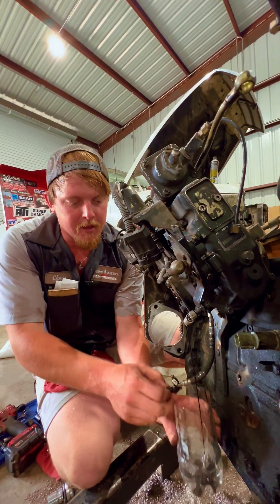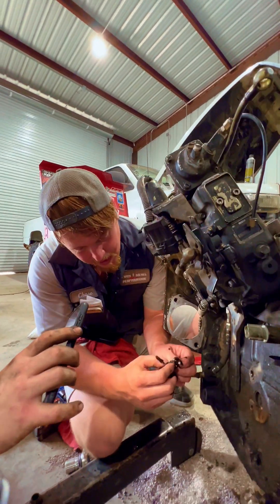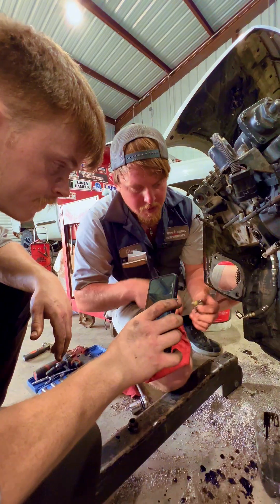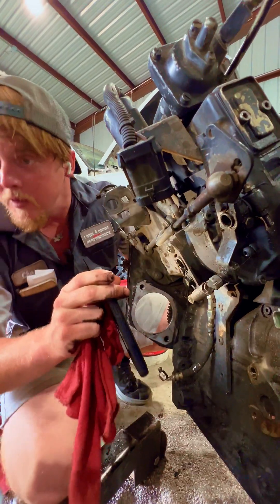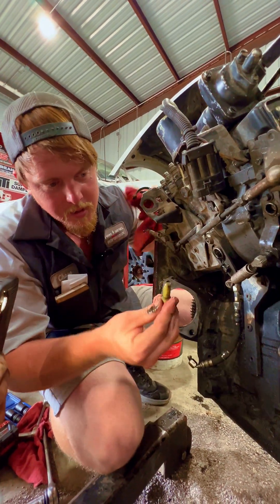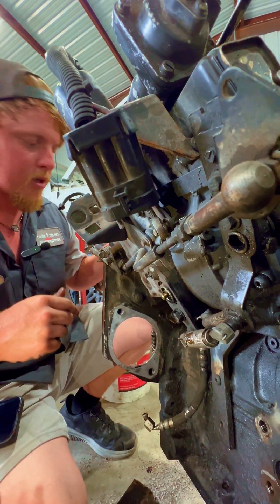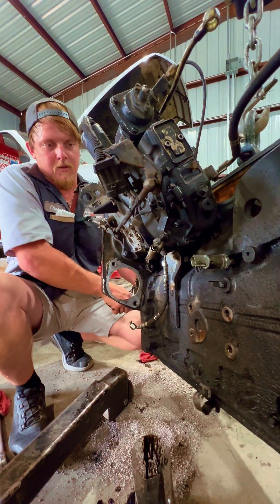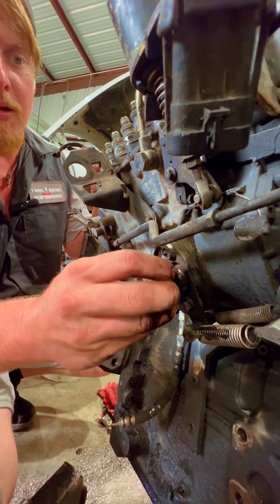Pull this out, then we can put a little oil out — just like that. You see this slot? What you do is find it, make sure it's lined up, stick it in there. On the outside of that — you see right there, you see that key? You have that horizontal like that. Look in there, you see the pin? It looks like a flathead screwdriver sticking back at you. Run this in here, perfectly horizontal. You can line this up and find it like that. You might have to bump the engine just a touch — retarded on the timing — so you can bump the engine over just a touch. See it pop in — right there, done. We're locked in. I always just tap it like that. Put this back on here just to keep it from falling out.